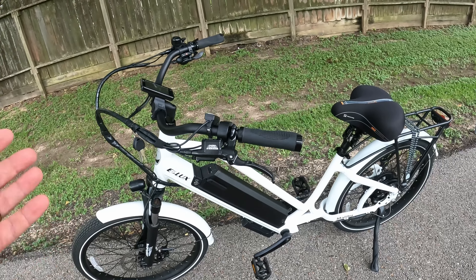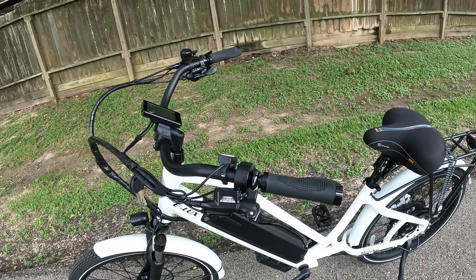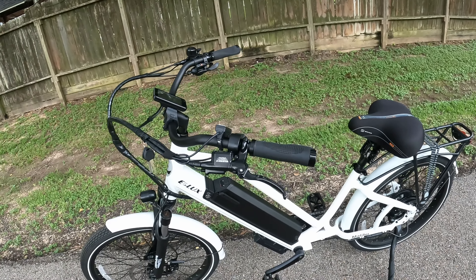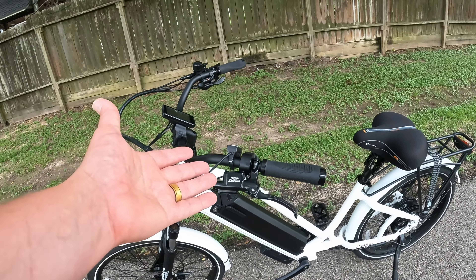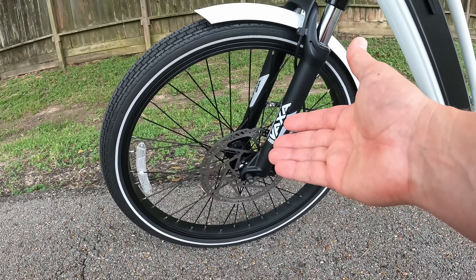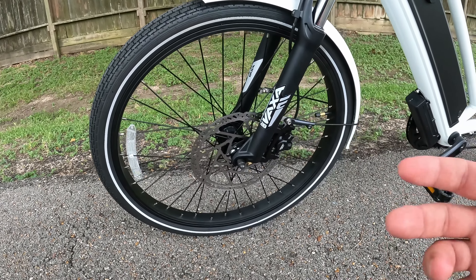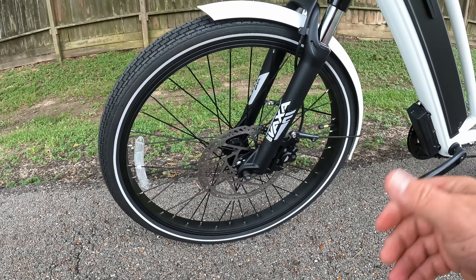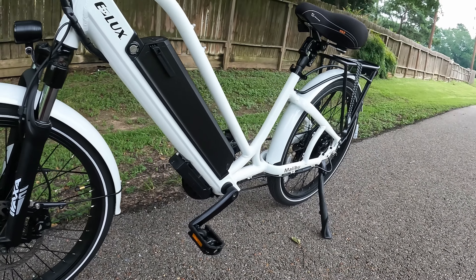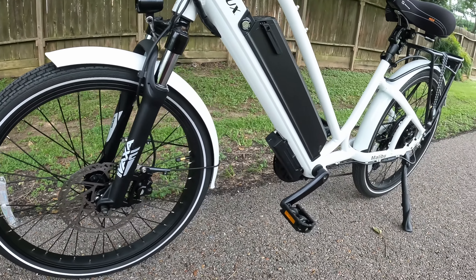As we go through it you can see a lot of similarities between the Malibu Mini GT and the traditional Malibu GT. On brakes, Elux has what I'd call a trademark setup across all their bikes: a 203mm rotor in the front — which gives more braking area — and a 180mm rotor in the rear. It's kind of a mullet setup in the braking world, and Elux does that on all the bikes I've tested so far.